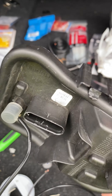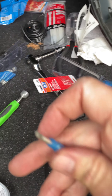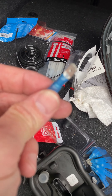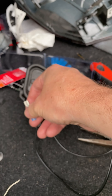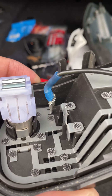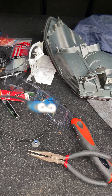Now that I've got the cable run through the back and hooked up here, soldered in, I'm going to take a male to female adapter. This is your male and you've got your female. What you're going to do is hook up your male end to this brown wire, your female end to the other end of the black wire. I'm going to cut this wire down — it's not going to be this long — but that way you just plug these two together and you should have power back to your signal. So it's soldered in, line run through this hole, out through the back, notched out to the female adapter.